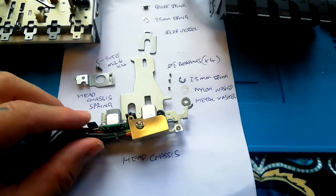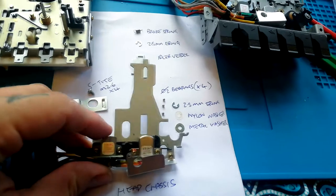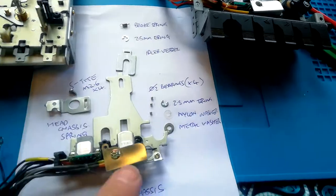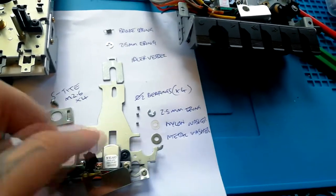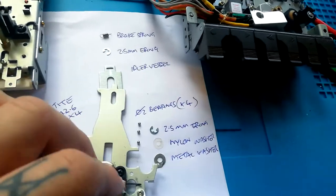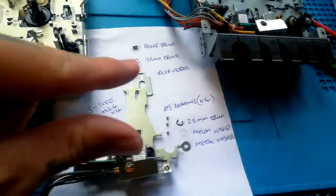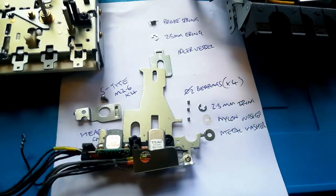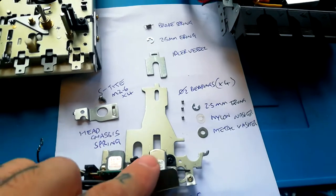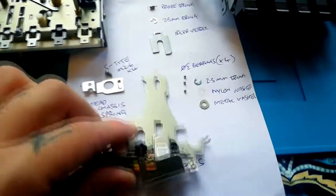Here are all the parts you need to take off to remove the head chassis. The head chassis is this metal plate — obviously these are the heads, there are various springs in here. This black plastic piece is called the head base. There's frequently a problem where this spring causes this piece of plastic to break — not the case on this model — and you have to re-jiggle this spring to make the heads engage properly. Third Island has done a good video on that, so I'll put a link in the description. For the purposes of what I'm doing, let's just call all of this the head chassis.